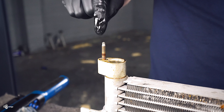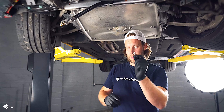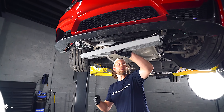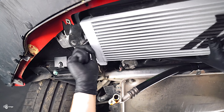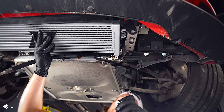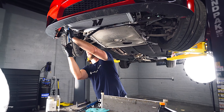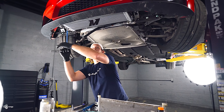You may notice that on the original oil cooler it has a bolt that's built in. With the Mishimoto one, it actually gets new bolts, so you're going to just thread that directly in. At this time, we're going to take the cooler and put it up in place. The nice thing is it's not full of oil, so it shouldn't dump oil on your head. Hand thread one over here and one on the other side so you don't have to support the weight of it. Then snug them all up by hand before torquing them down to 15 foot-pounds.